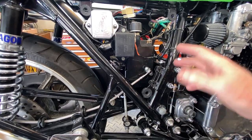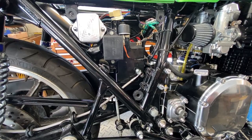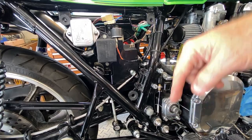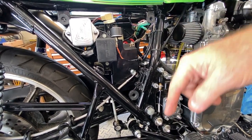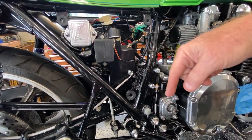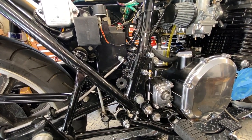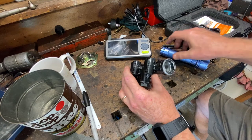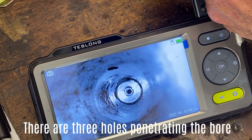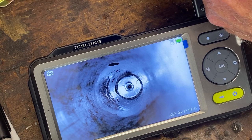If I can get the reach with a boring bar in my boring head and get it fixtured, I believe I can run an indicator in far enough to pick up square, make sure we're concentric, and then send it home. Now I know what you're going to say — there's a cross hole in here, you can see it right there.